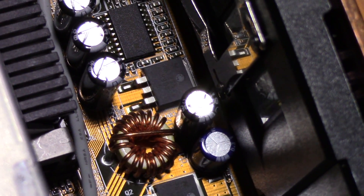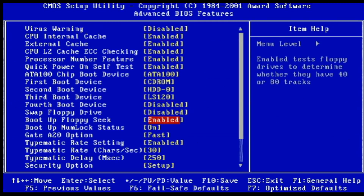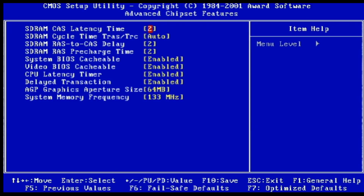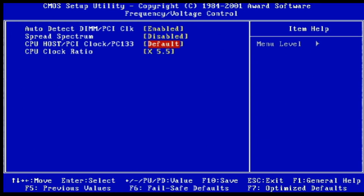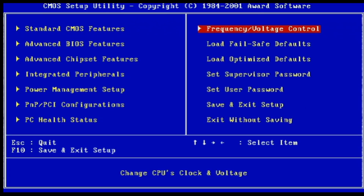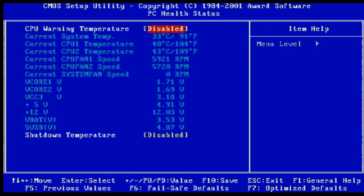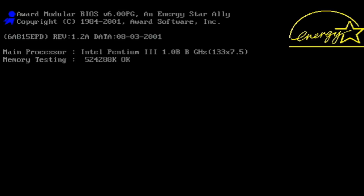So far I have absolutely no stability issues on the ACorP motherboard. The BIOS is a bit limited but has some nice options — pretty average overall. It allows tweaking of memory timings and has a jumper-free bus speed option, but no voltage adjustments, so overclocking would be pretty limited. There are jumper settings on the board for base clock speed, and the BIOS bus speed option starts from that point — in this case 133MHz. It appears to go up to 160MHz, which is nice, though whether it can actually operate at that speed is unknown.